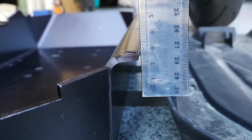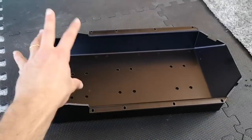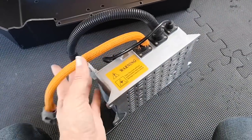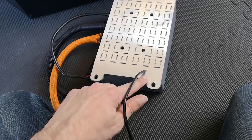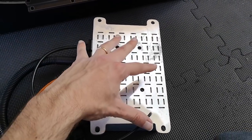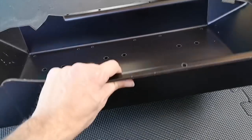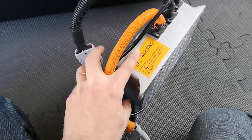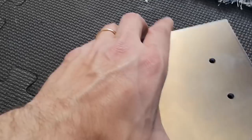There's a difference of about two centimeters. For people who order this pan from now on, all the chargers and stuff are going to be mounted already and wired up. But since I ordered the chargers about a year ago, my chargers are unmodified — I still have the Sumitomos and a fan wire coming out the bottom. This is the part that all the heat disperses out of. It's supposed to sit flat, flush with the bottom of the pan so the heat spreads out, because it's really thick and works as a heat sink. So this fan sticking out the bottom is a problem. One way to do this is to get a grinder and cut a groove to lay the fan cable in.